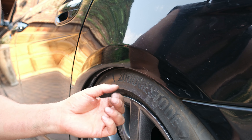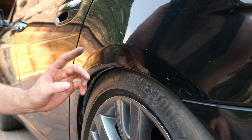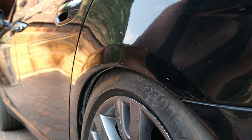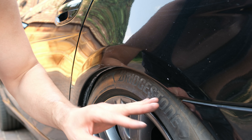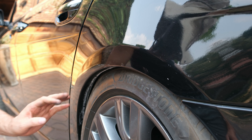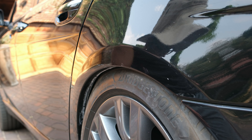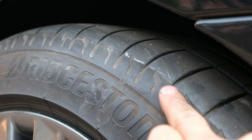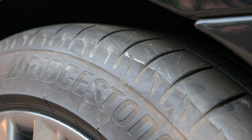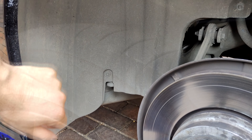There's no way I would be able to put a thicker spacer than 15 millimeters - in fact 15 millimeters is already quite thick because I have to cut away this whole side. To answer the question: I wouldn't be able to put a 25 millimeter spacer on this vehicle unless I flared the wheel arches, which means panel beating. So what I'm going to do is remove the wheel, move the wheel arch cover, cut this lip off, cut some of the wheel arch and plastic inner away, then seal it with foam or a membrane.